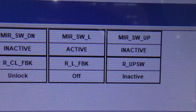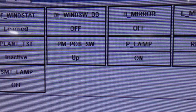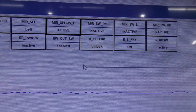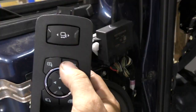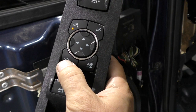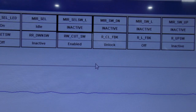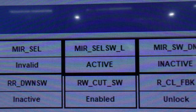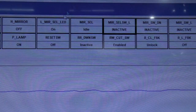When I press any button it says active. If I press mirror up and down, it switches left, right, down, up — telling me which position the mirror is moving. Now I press the fold-in button and it says active, so it recognizes that I'm pressing it. But when I look at the mirror cell parameter, it says 'invalid' — like it doesn't know how to translate this activity. It's almost as if that button is not programmed into the module to do anything, because it says invalid.